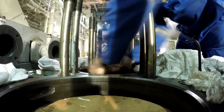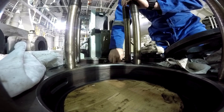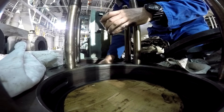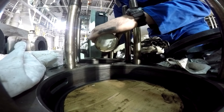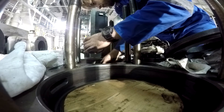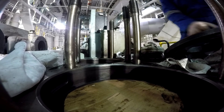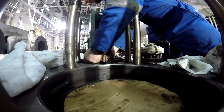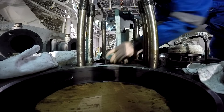First, here you can see in time-lapse I have already started lapping on the top of the cylinder liner. The grade of grinding paste I apply is 360, and I also use some oil together with this paste. The oil also has a cleaning effect on the surface, helping distribute the paste better. The same tool is also used for cylinder head lapping.